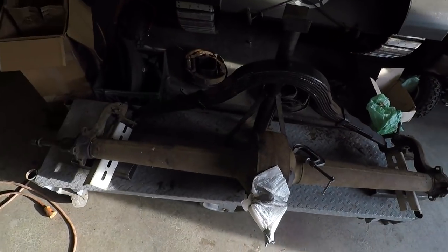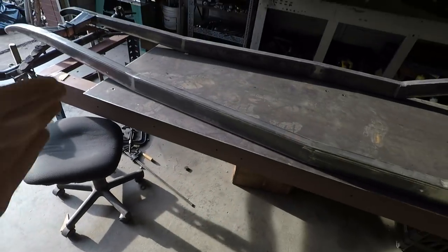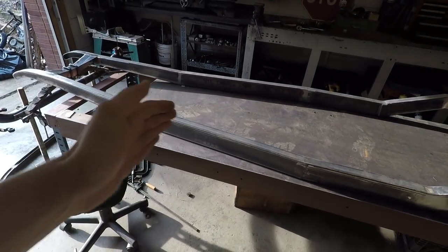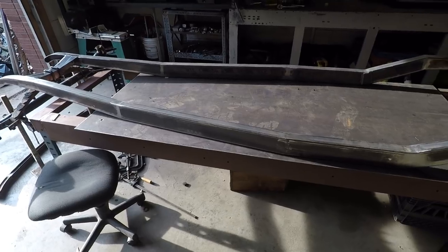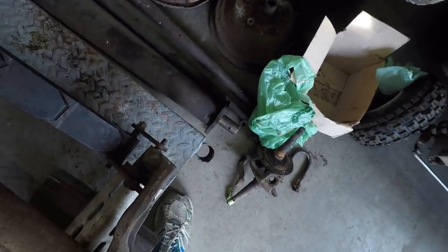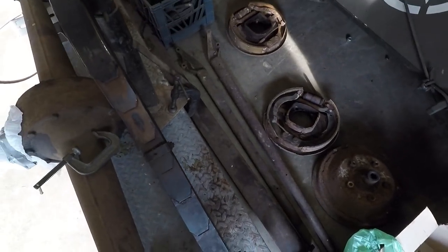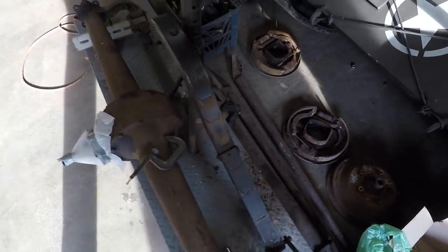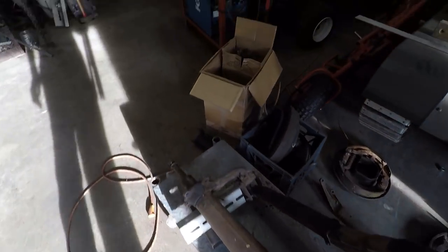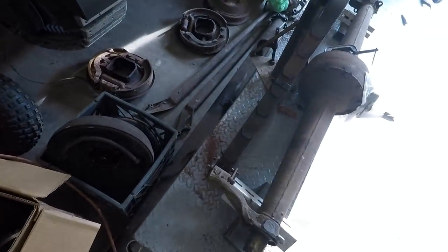And an open drive shaft is a lot more convenient for everything because it doesn't matter what kind of engine or transmission you have in there, or the amount of space that takes up, because you can just lengthen or shorten the drive shaft. With a closed drive shaft like this though, you have that big torque tube there and the drive shaft going up through it, and you're going to have to shorten or lengthen all of that, and it's just a world of complications. So that's something to think about for the future. I might end up going with this. I might just use the closed drive shaft though.